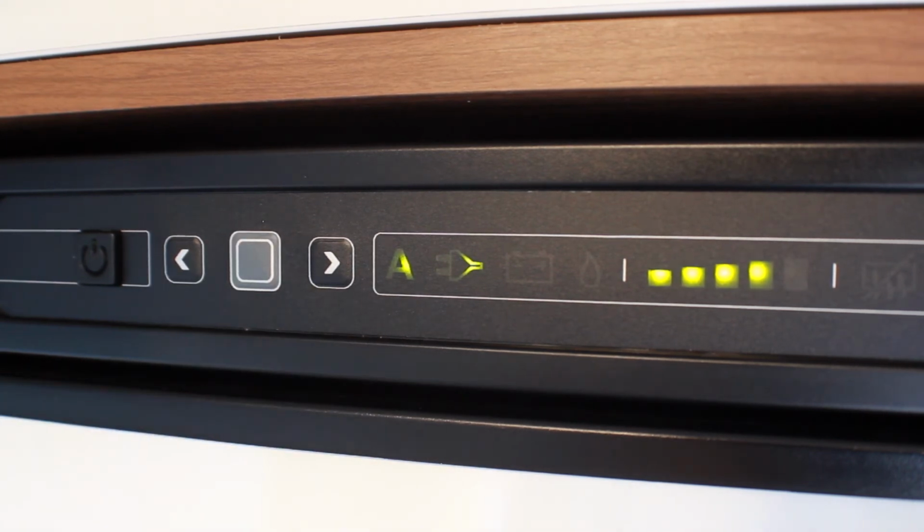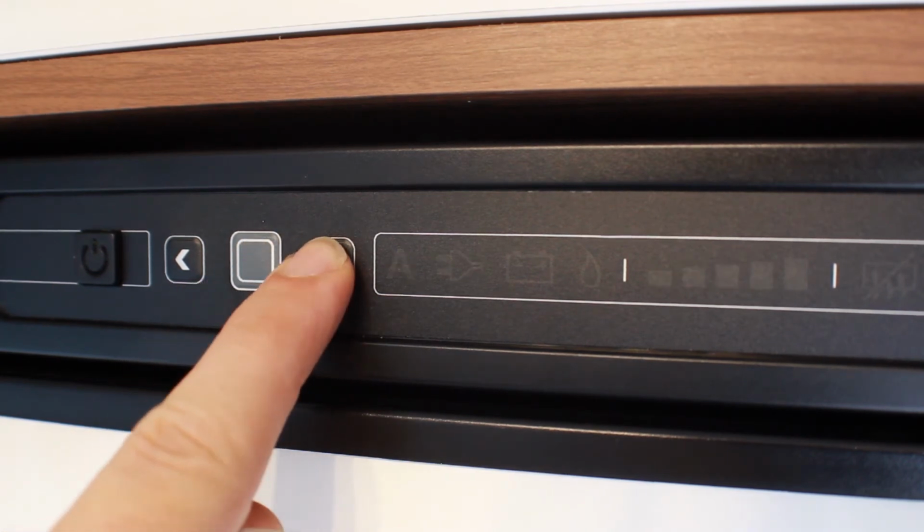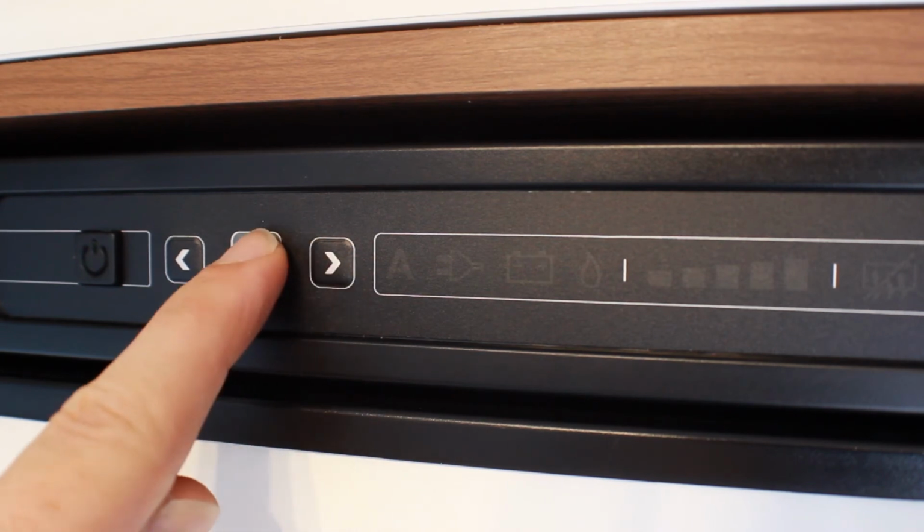Before driving, switch the power source to the battery symbol. Once the engine is running, a current will then be supplied directly from the alternator, which will maintain the temperature of the fridge whilst on the move.